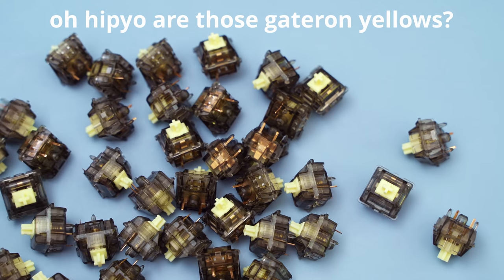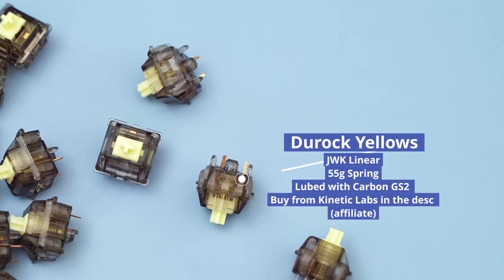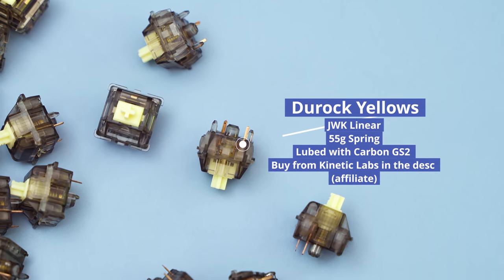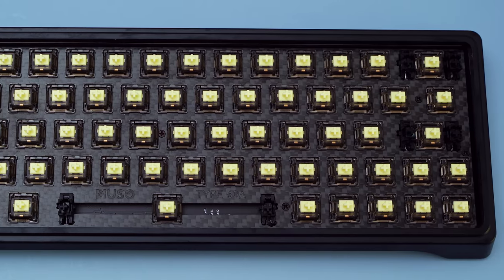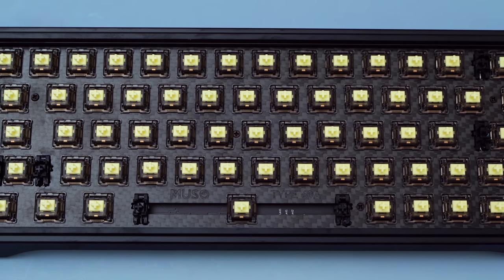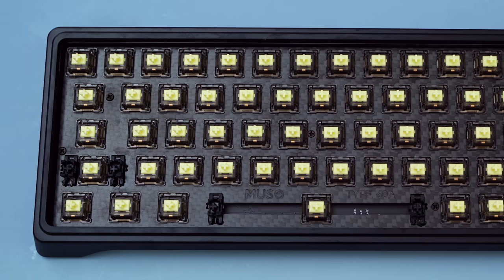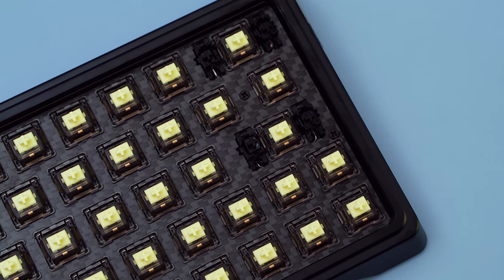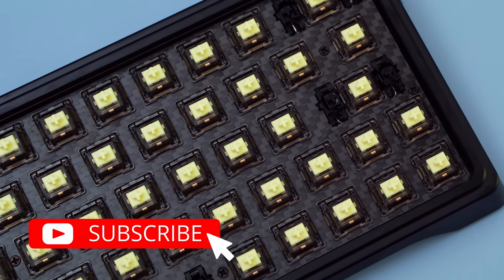Are those Gateron yellows? No, they're Duroc yellows. I don't even know why you would think they're Gateron yellows — the yellow is a totally different shade of yellow. These are some 55-gram linears that I purchased from Kinetic Labs. I lubed all of these by hand, although it really wasn't necessary as they came with pretty good factory lubing. I wanted to give this board the best shot possible with the switches, even though most of the switches it comes with are stock Gateron switches. It's really hard to go wrong with a Duroc linear, and these are just a nice light version of them.